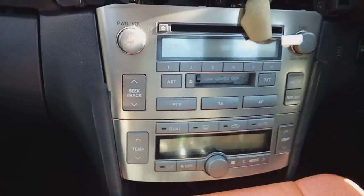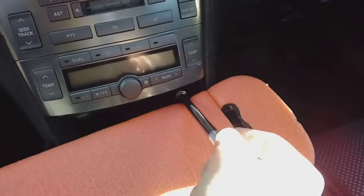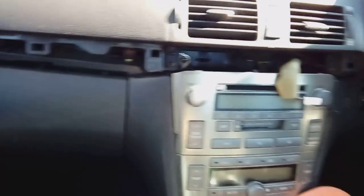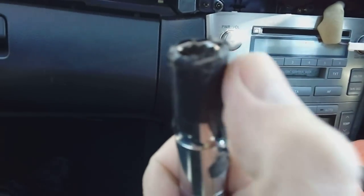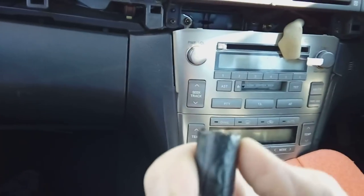The main thing you want to get to now are the actual mounting bolts — they're all 10mm. There's one underneath, loosen that off, two more, and the other two are tucked right under there. Keep those bolts safe. If you think you're going to lose them down the back, which you probably will as they're quite deep, put a bit of electrical tape in the end of your socket. Stick it over and shove the socket over the bolt — that'll stop the bolt tumbling down behind the dashboard and it'll come out on the end of the socket.